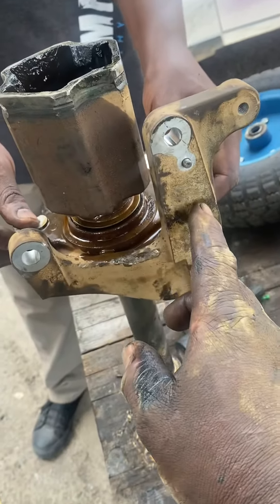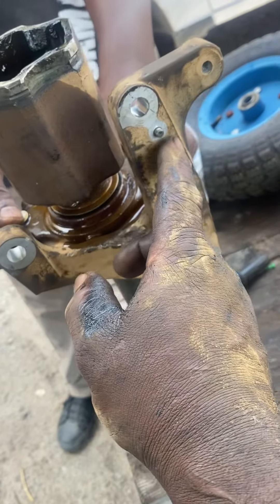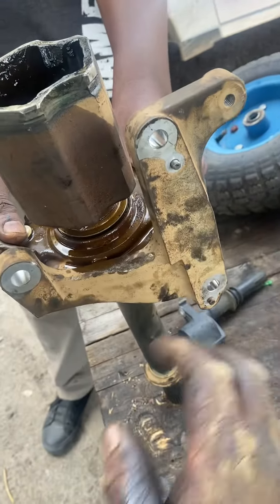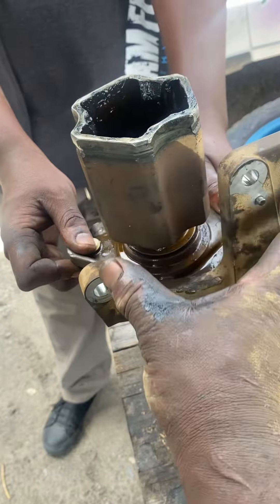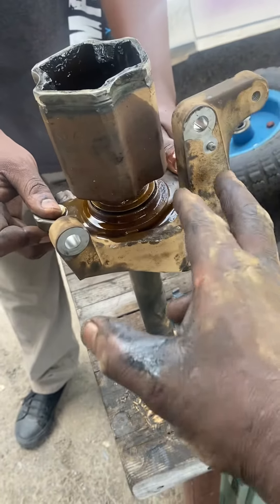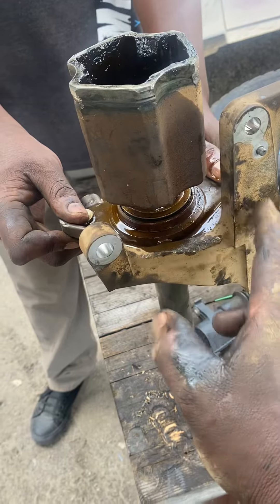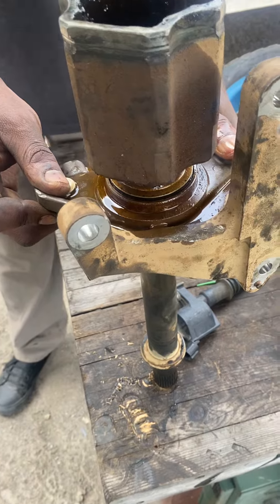This cage is held by dowel pins — that pin and that pin. Just make sure when you push this away from the block, these pins are clear, and you just pull out the drive axle straight. On the Juke it's easier to pull out the whole thing; on some of the Nissan Altimas it can be a little bit challenging, but this is no big deal. Again, this is brother Josh — enjoy driving your Juke, bye.